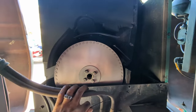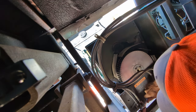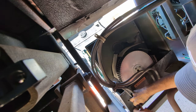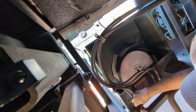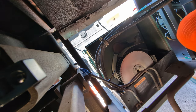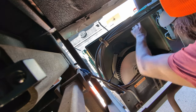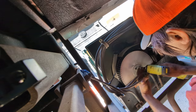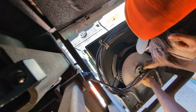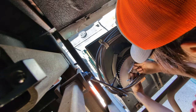We're just going to take that fan off and see where things go from there. Always lift the ground first — try very hard not to touch anything else. Now this motor cannot spin and hurt us. Luckily they standardized on a lot of the sizing in here — everything's 10 millimeter pretty much, with some 12 and 13. And off comes the fan.